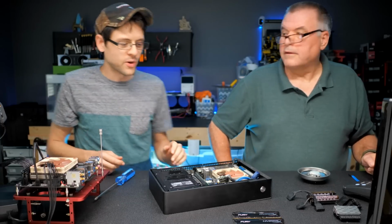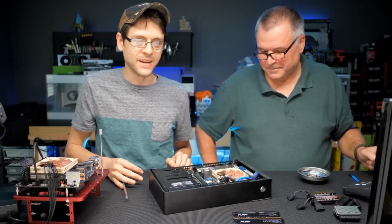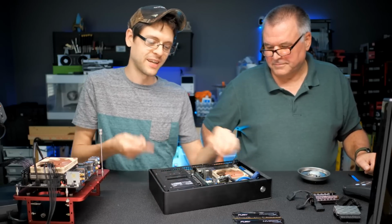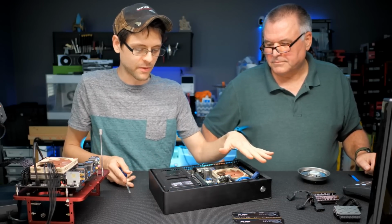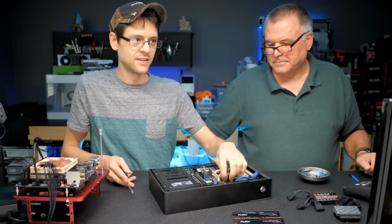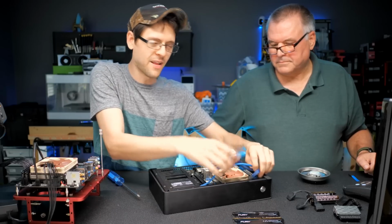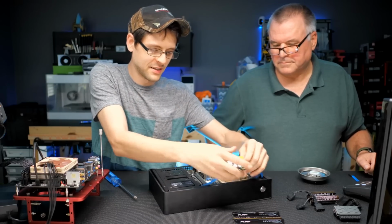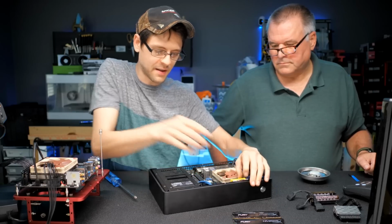My viewers are telling me how to take apart my computer case because I've forgotten. But as Mo2Mo1Mo says, you've got to remove the drive first by sliding it over the motherboard, right? Yeah. Then the SSD brackets, and the GPU, then the motherboard. Yep, that sounds about right. Thank you. Yeah. Tuck that Pico in there.